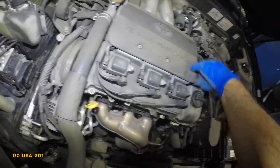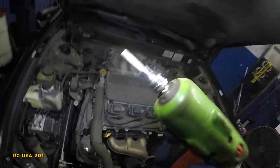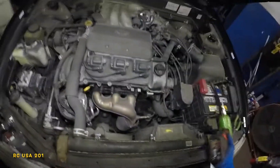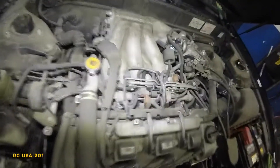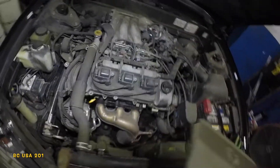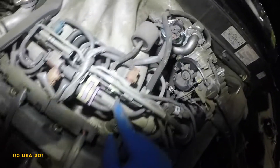Make sure you also replace your EGR valve. We took off these two Allen key bolts — size number five Allen — and once you get those two off you can pop the cover open. It's held in by clips that grab onto notches. The EGR valve solenoid is right over here; it has a Phillips head screw in the back and a connector.